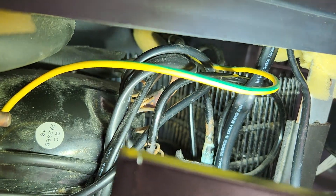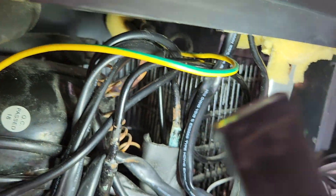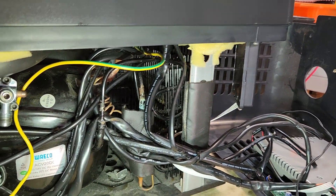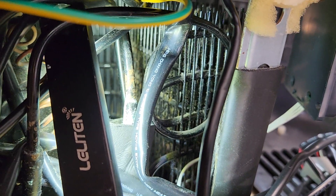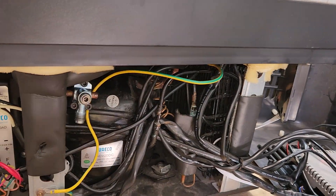As the refrigerant comes back into the compressor it gets compressed from gas back into a liquid and in doing that it gets very hot. As it exits the compressor it goes to a coil - this is called a condenser. You may recall these used to cover the entire back wall of old fridges, allowing convection cooling with no fan. This smaller modern condenser has to have a fan, and it's probably not that efficient given its physical size. The fan and condenser are critically important for maintaining temperature inside your fridge.